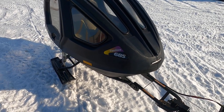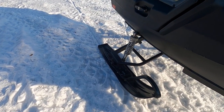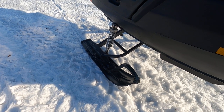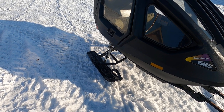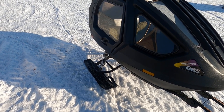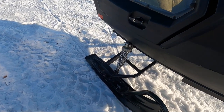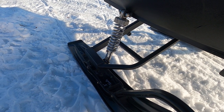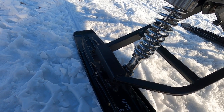This is an older one. It actually had steel skis on it, and there's a local guy here that has a snowmobile salvage yard. I retrofitted some 3-inch Arctic Cat spindles on the existing suspension. The old steel skis were three and a half inches, so I actually shaved down the bushings on there.